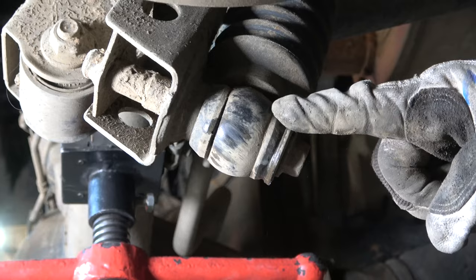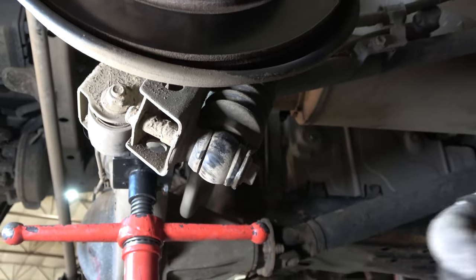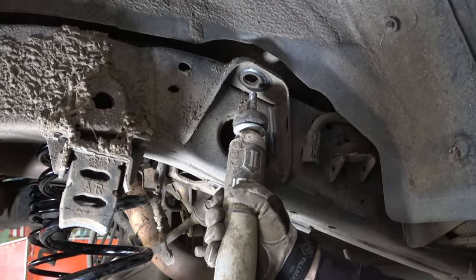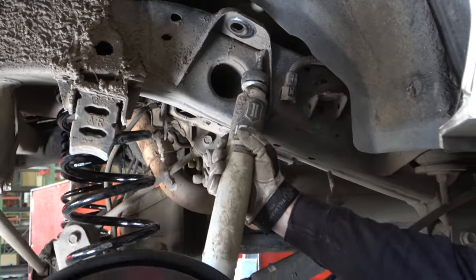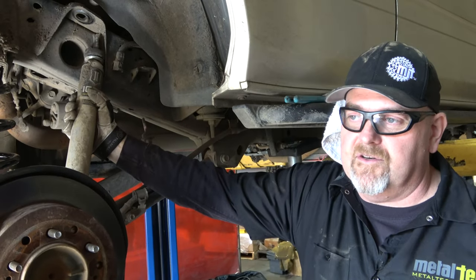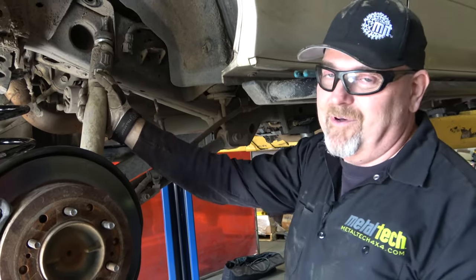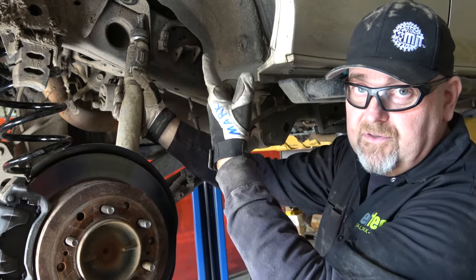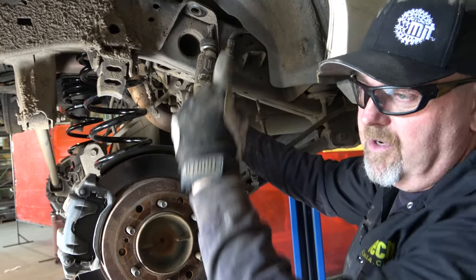There's the lower shock mount causing the shock to want to lean forward. We don't take this off — we leave this on. The shock is leaning forward and I need to just push the shock back, hold it there, then bring the axle up and put that through the hole of the frame. The way I'm going to do that is lift the back axle up. At home you're going to be doing this on a driveway or garage floor — just use jack stands and a floor jack. I'm going to use a screw jack to lift this up, bring the axle up, and allow me to guide the shock through the center hole. I'm going to purposely lift this up a little so the shock is kind of bound up there at first — then I can pull down on the shock, move it to the hole, and it'll pop right through.